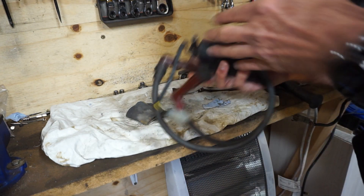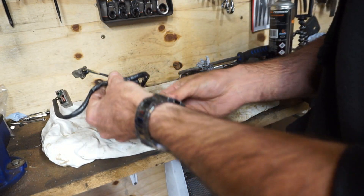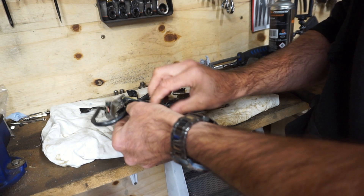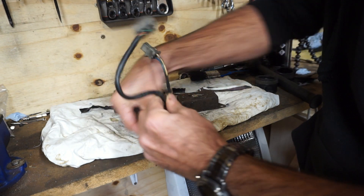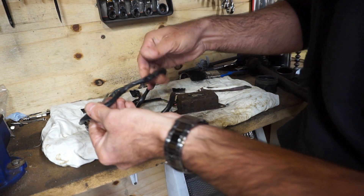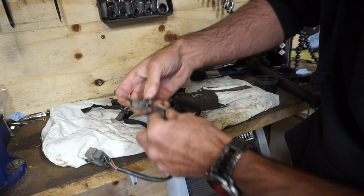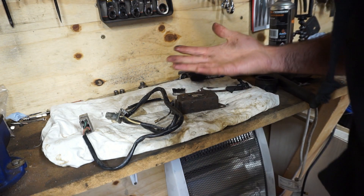Now let's move to the CDI. It's got more insulating tape which comes off and just leaves a big sticky mess - that seems like a good idea when you put insulating tape on, but long term it's not the right stuff for wrapping wires. So far I can't see it's hiding much - I'm not really sure why it's even on there, because the original plastic underneath looks like it's been in good condition. Someone must have thought it was necessary at one point, maybe just for these two wires. Anyway, let's get rid of this and give it a good clean.